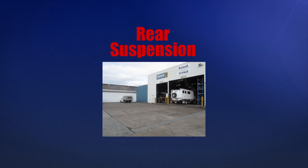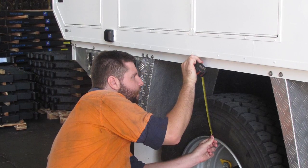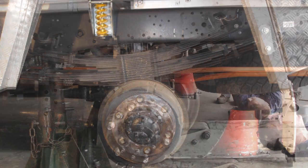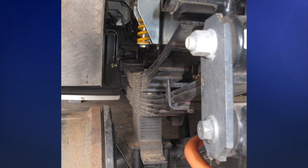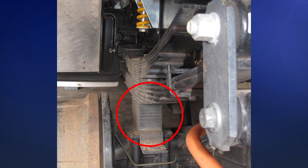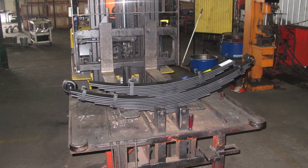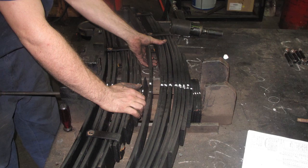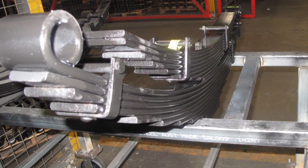Now we need to address the rear springs. Let's start with our before measurement, then jack the vehicle up and get it onto chassis stands for removal of the old rear springs. We will be replacing them with stronger spring packs which will improve the rear suspension strength and height. Our stronger new rear spring packs will not need as many of those now unnecessary bottom spring packer plates that have been used to artificially lift the vehicle height and don't actually provide any strength to the spring at all. We needed to recamber the new rear springs to suit the special load of this vehicle, and when we do this we must also factor in the improvement in front height we have achieved — that is where experience pays off.